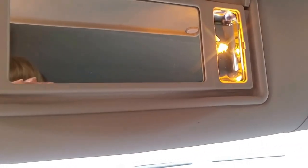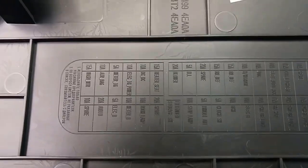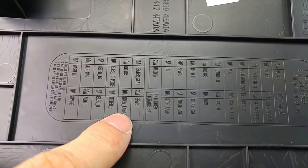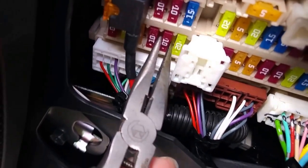I already made a mistake — I blew the fuse of the interior lighting. So I had to remove the cover of the fuse box and look at the diagram to find which one is for the interior. As you can see, it's the room lamp, second row next to the 20-amp one. So in order to be safe, remove it first before you do anything.